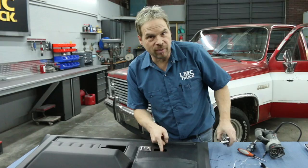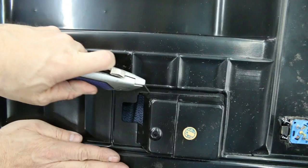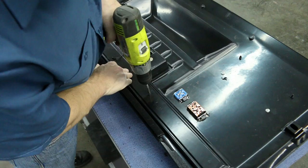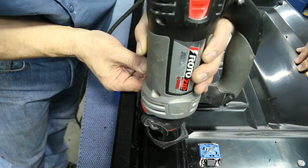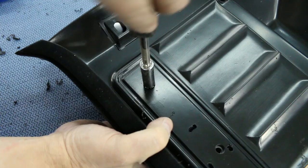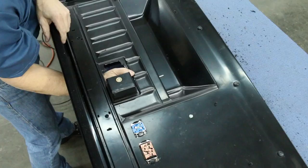Obviously your openings don't have to be perfect — just make sure that the spring clips on the sides of the switches have enough material to grab onto and get a good bite. First, we scored the pre-marked lines on the back side of the panel. Then the plunge cutter cuts the center, allowing for some leverage. Finally, we use pliers to break away the plastic on the scored lines, and that gives us the clearance we need for the new bezel. The deluxe trim panel needs several mounting holes drilled in the door panel — they're all clearly marked from the back — and there are some slots that need to be opened, for which the plunge tool works great as well. Speed nuts hold the trim piece in place and are installed onto the plastic studs on the back side of the trim, which stick through the newly drilled holes. The new armrest pad is installed before the panel goes back on the truck and is held in place with a steel clip on the back side of the panel that slips over the stud — a long three-eighths socket works great for installing the clip.